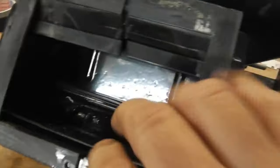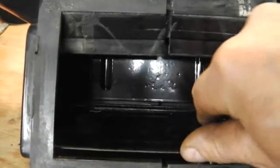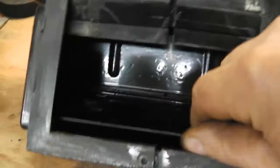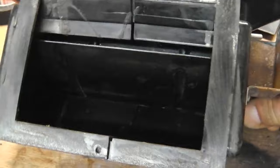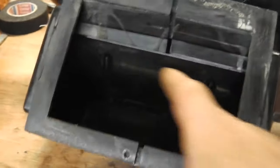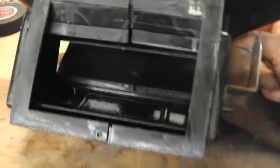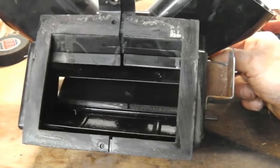We only need to do the inside face of this curved flap, because if you put too much foam on the back of this, it's not going to be able to open fully. It's going to land about there. It also doesn't make a clangy noise on the opening of it. If you listen, it doesn't actually do that, and it wouldn't have any advantage having foam on this side. There is no action, it's to close and seal and then open that way. So we only need it on the inside face of that one. Both sides on the other flap to stop that noise. We want it to just make that nice closed door sound.